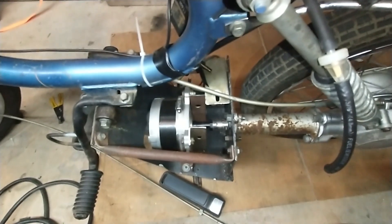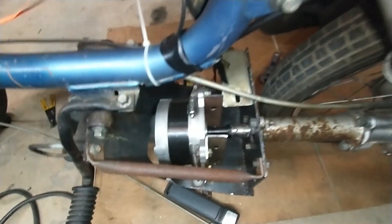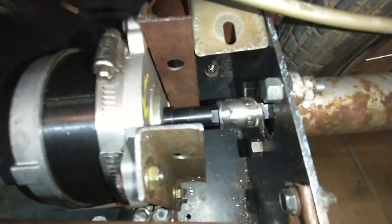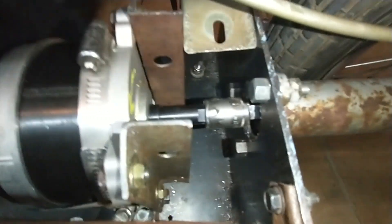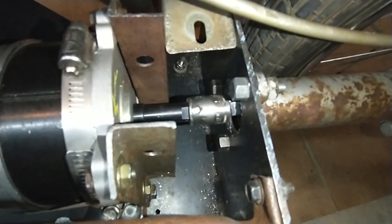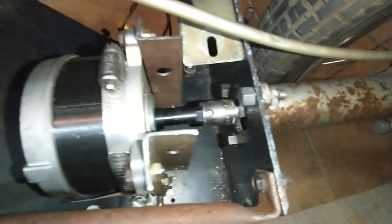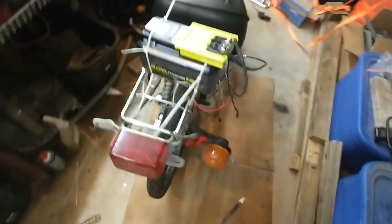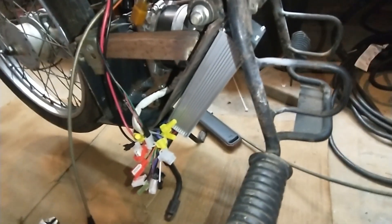At this point we've got the motor installed in the bike and more bracing has been done. To couple the motor, a socket is attached to the nut that goes under the end of the motor, and at the other end a piece of 3/8 inch square keyway was welded into it - all installed in a vise, pressed together, and then welded. So now it is connected. We've got the wiring hooked up and the box has been installed for the controller.